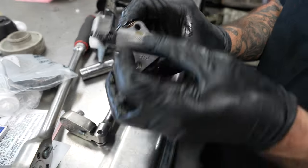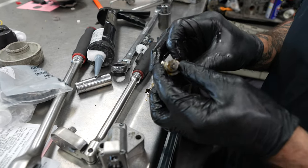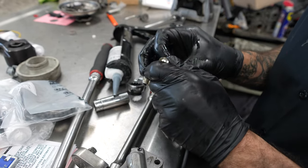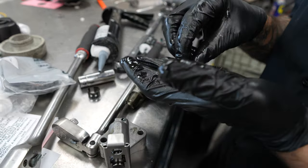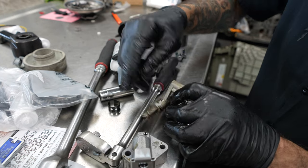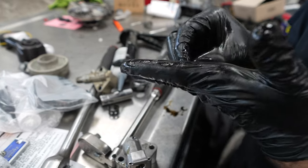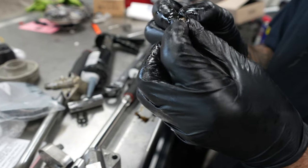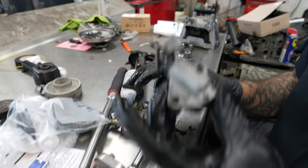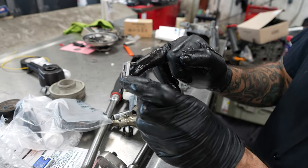This is the updated tensioner — it's got the retainer. That's what breaks on the old ones. The little cam is supposed to lock it but it doesn't do a very good job; it bounces and strips. You can see this one's pretty worn down on one side — that's the fail point on the old style tensioner. They've addressed that on the new one: aside from being hydraulically pushed out, it has a nicer mechanical lock.